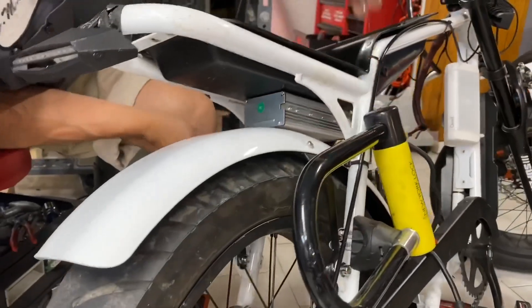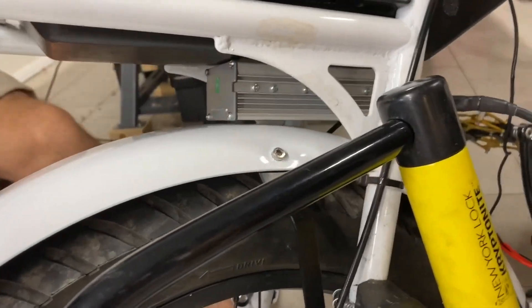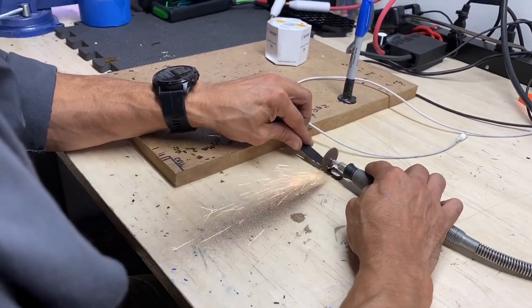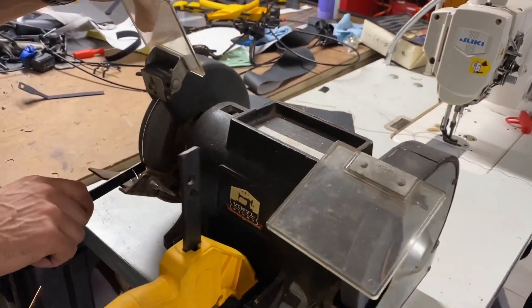The overheating was very apparent on riders over 200 pounds, so we needed to make the modification to my bike as well. In order to store the controller under the seat flush, we needed to make some modifications. We started off by cutting the fender brackets to shorten how tall the fender was.